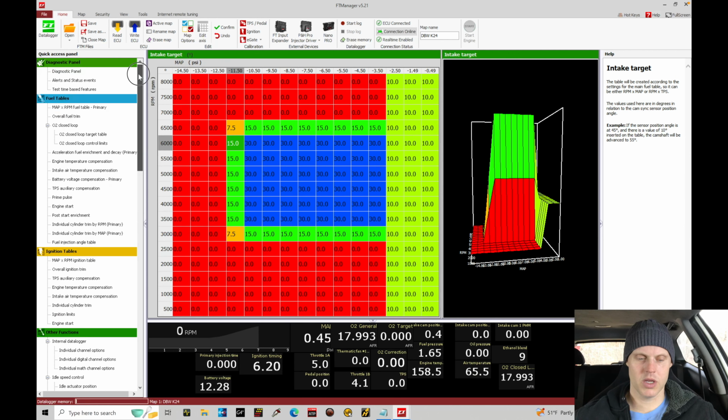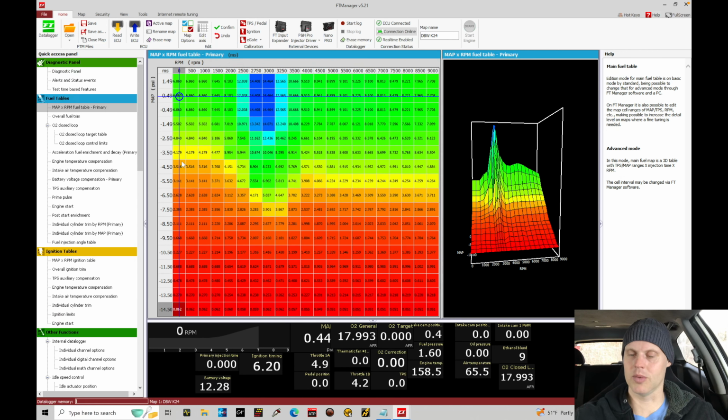All right, let's go in here. Let's get back into our fuel table, make sure it's out of gear. I'm going to power cycle it down, give it a second, power it up, give it a second. Let's see if it's going to fire clean now. So it fires okay right there. It wasn't awful. All right, let's let the wideband come online, and then we'll begin and do another pull. All right, O2 is reading right here, so let me throw my headphones on and let's try this.